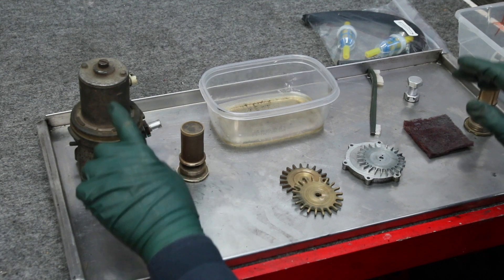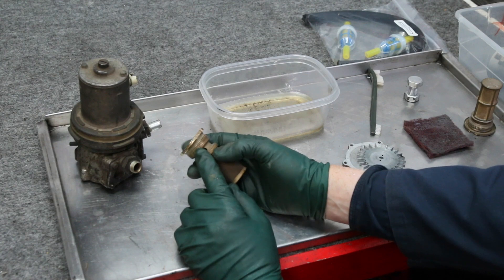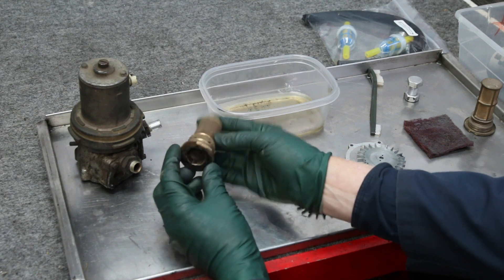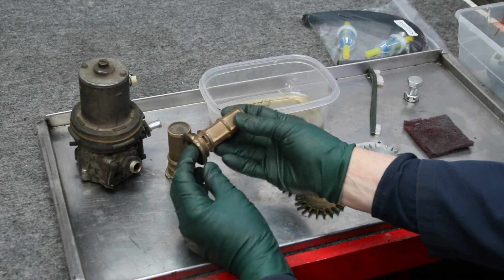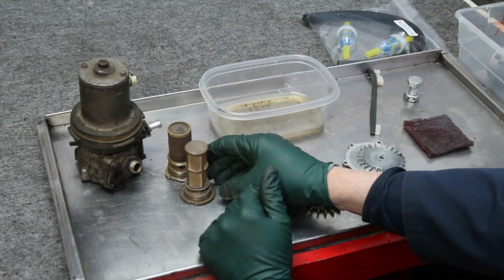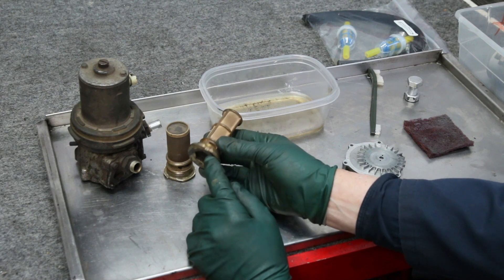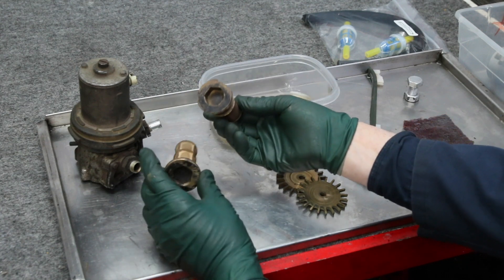These cars use this style or the shorter style electric fuel pumps. When I pulled the tank screen on this car, I noticed a big chunk of brass out of the side — and that's not the first time I've seen this. Another one also has a big chunk of brass missing. Why are these damaged like that? Somebody didn't have the right wrench — it takes a 22mm hex. Most people don't have that, so they resort to a chisel and bang on it to loosen it. I've probably seen a couple dozen of these.